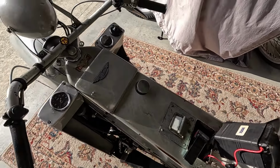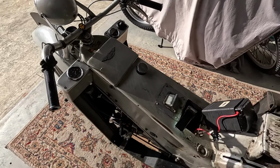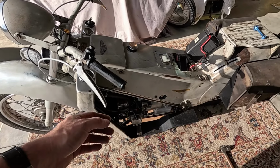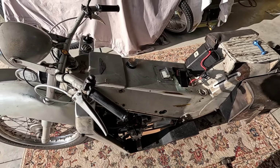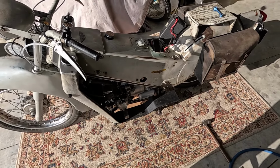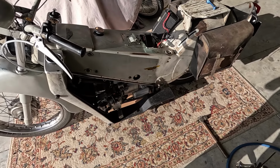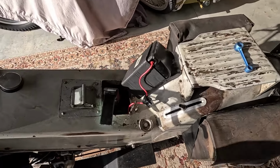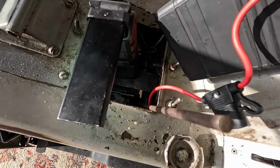And so now the clutch is fully disengaging, and you have to be really careful testing this, because obviously I start the bike to test it, and I accidentally let go of the clutch when it was in gear, and the bike took off that way, not very far luckily. It came off its stand, and then promptly stalled, luckily. And I caught the bike before it fell over, but all the tools and everything went flying. But that's why the clutch didn't feel right, and that's why that adjustment is important.